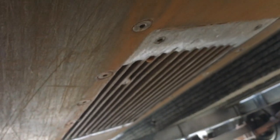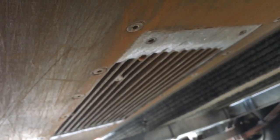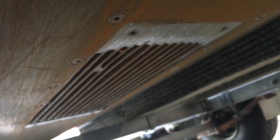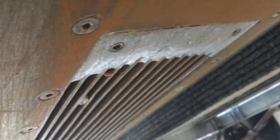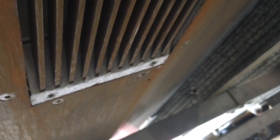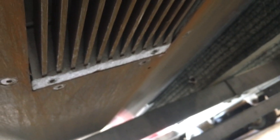You can see these are the intake bolts — five bolts either side holding down the intake. Those bolts go right through the steel, through the intake spacer block and through the intake foot itself. And then there's the cutout in the steel for the ASP grille. We can also do them for Hamilton Jet and Southern Jet for bigger boats. The delta is just wide enough to accommodate the front of the ASP grille, and then you can see two bolts up the front holding the intake in.